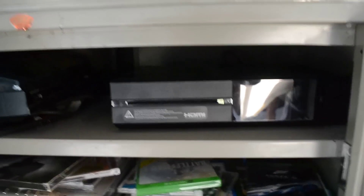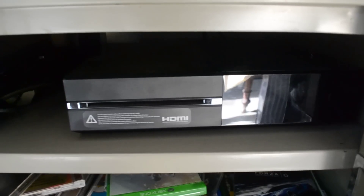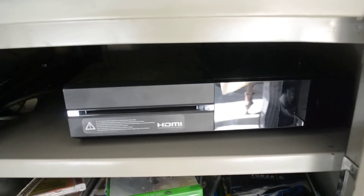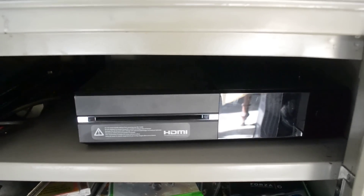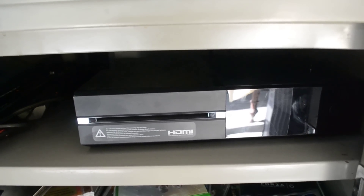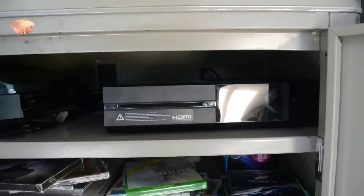So here is the Xbox. First thing we need to do is press the bind button and the eject button and hold them together. Whilst doing this, you need to press the power button. You should hear a power-on tone, but continue to hold the other two buttons. In about 15 or 20 seconds you should hear a second power noise. This opens the Xbox in recovery mode, and what you need to do then is reset your Xbox — but you can choose to keep your games and data. Then you go through the setup again and your Xbox is fixed.